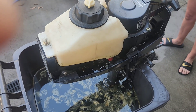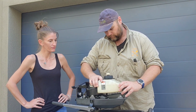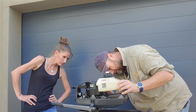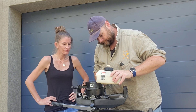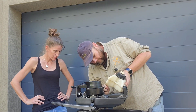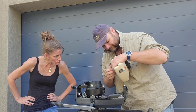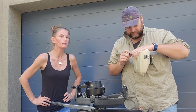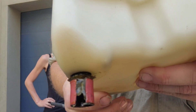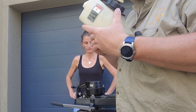Okay guys, I've undone the fuel tank - should just be able to lift this out with a bit of effort. Take those washers out so I don't lose them. Now I should be able to twist this off. And what's that part, John? That's the broken part. Oh yeah, that doesn't look good. That almost looks like someone's tried to repair that - there's a split in the fuel hose and it looks like there's some sort of glue in here as well.